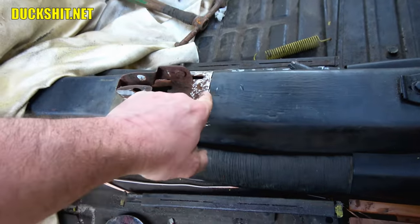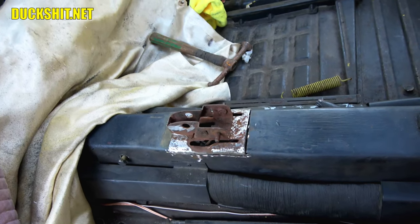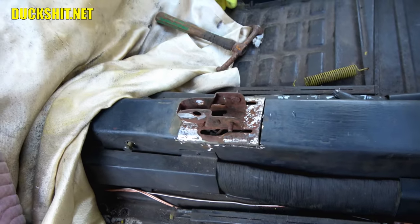Get the rest of that dent out of there, and that should plane off just fine. And we'll start welding on this thing in just a minute. All right. Meanwhile, I'll get the thing on a wire wheel and clean some more of that rust off of it. And then I have to clean the paint off around the surrounding edges. But we're getting somewhere. Yes.